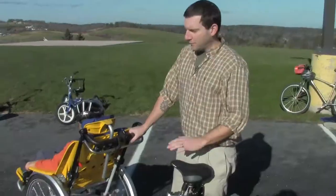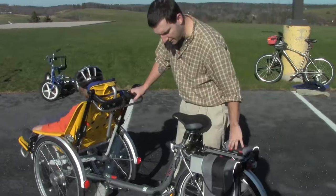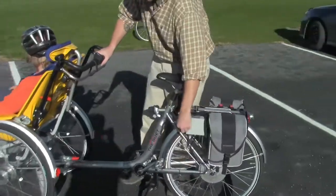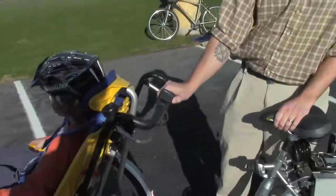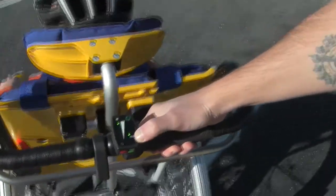I much prefer an air compressor. The Duet Cycle is electric motor assisted, which is awesome. You've got these battery packs on the back here, and there's a key on the left-hand side of the seat. Turn the key to the on position, then press and hold the red on-off button on the handlebars for a couple of seconds — the green light will flash and then you can let go. A little green eco light comes on and you know that you're ready to ride.